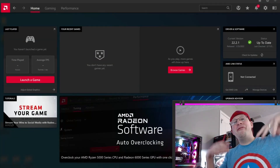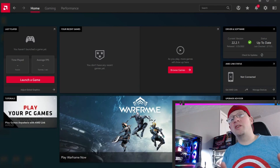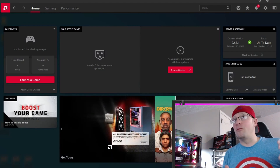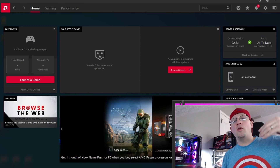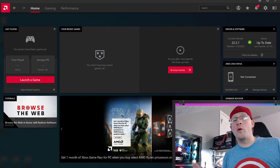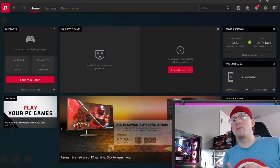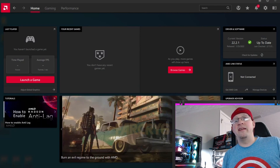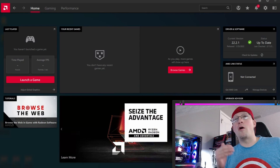We finally got all the testing done — I've got a lot of hours into this one. Before we dive into the nerdy numbers, I want to show a quick and dirty how to overclock this card. It's a pretty easy overclock because it doesn't have a ton of headroom. With all AMD 6000 series on Windows, I highly advise using the built-in Radeon overclocking software — it just works better and sticks better. I love MSI Afterburner, but for the 6000 series it does not hold settings properly and it's often fighting with the AMD settings. Go with the Radeon software if you're on Windows.